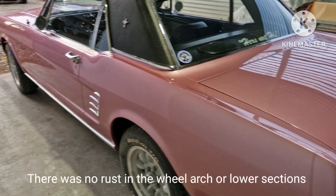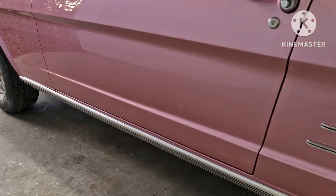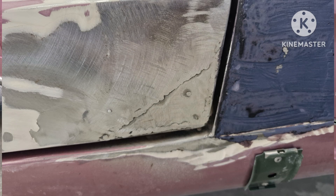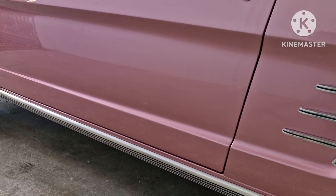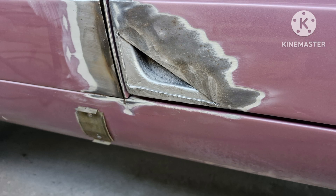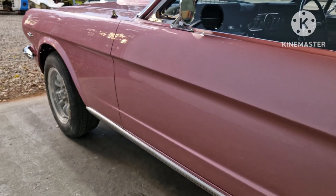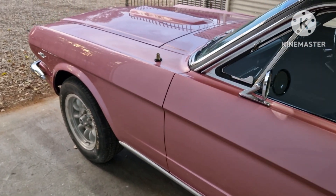The doors were nearly perfect, but there's this thing I've been doing with cars now. Any spot where a car will normally rust — the bottoms of the doors — if there's no rust there, I'll go ahead and cut a patch out anyway and you'll actually find a bit of surface rust underneath. This car was probably one year from having rust bubble out. You think about it: you've done the outside of the car, but then something inside starts rusting out and that comes back and bites you.